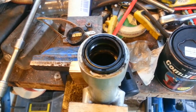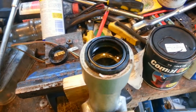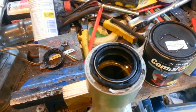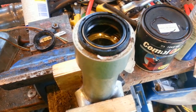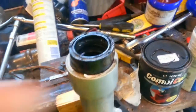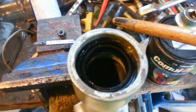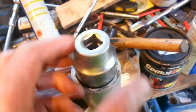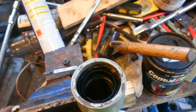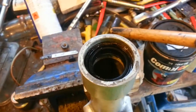Reassembly now. I've just cleaned it out with some WD-40, nothing too special. We have the oil seal — this is the important seal going back in. I'll just coat the edge with a tiny little bit of rubber grease, just the red stuff. I like to do that on seals, it just makes them go a little bit easier and won't denature them at all. I'm just going to put that in, probably just using a little block of wood. I finally got that seal in — that was a lot harder than I thought it was going to be. I resorted in the end to a 30mm socket on the top and hammered it in. Make sure you go in parallel — I didn't, and it was a lot harder. Hopefully on the second one it will go very smoothly. Now all we need to do is clean that feather, put it back in, and then start rebuilding the fork.